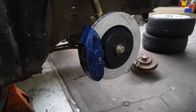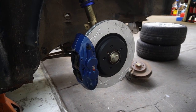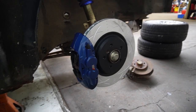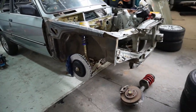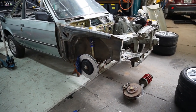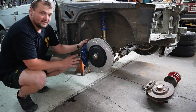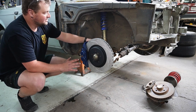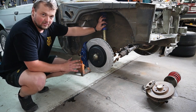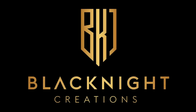Future Lewis here. I later realized that if you machine the rotor down to 340, you lose too much face or width of the rotor and it would start to chatter on the inside. So I'm going to persist with trying to get a different set of 18s with a more favorable offset and more brake clearance on the inside. So this is an M Performance G80 caliper, an HSV rotor, an E36 knuckle, and an E36 coilover. It would work. We'll be right back.